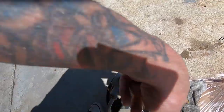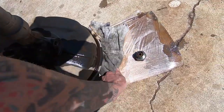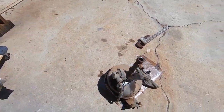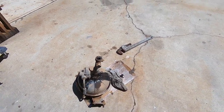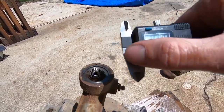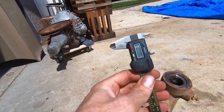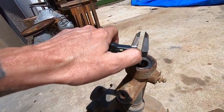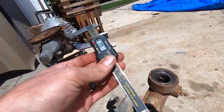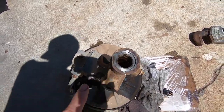That's got to be like a one-inch bore - it's not very big at all. Let me measure that. I think that's only like a one-inch, so it's not bad. A one-inch bore master cylinder - we should be good, probably even an inch and an eighth would work, it'd just push them even harder. We've got some calipers here, Harbor Freight special, zeroed out. Measuring just the end of this - just under one inch right here at the thread. The cylinder that goes in gets even more shallow, so that's pretty much a one-inch bore. Fairly simple.